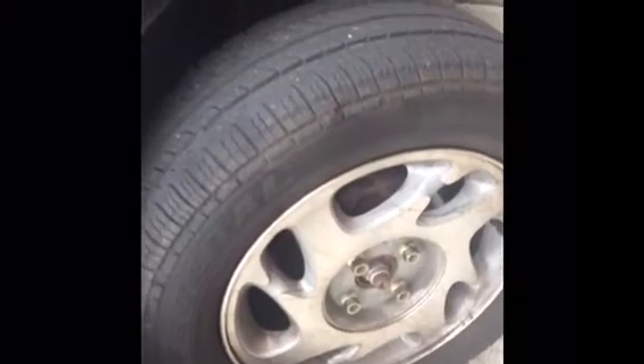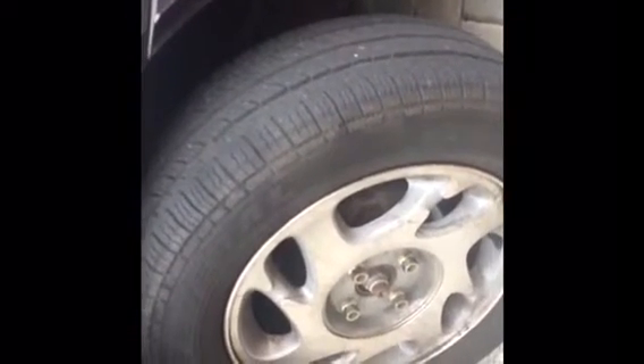The tensioner on this car is way down in there. So the way you have to get to it, you got to jack it up, take this tire off, take that splash guard off in the back, and then you can loosen and remove the belt. So I'm going to go ahead and do that, loosen up the compressor, and then I'll show you what's going on.